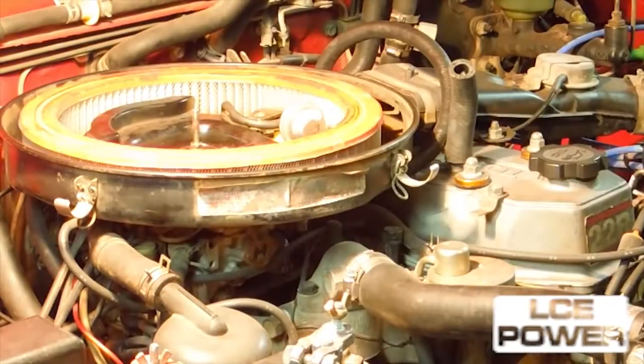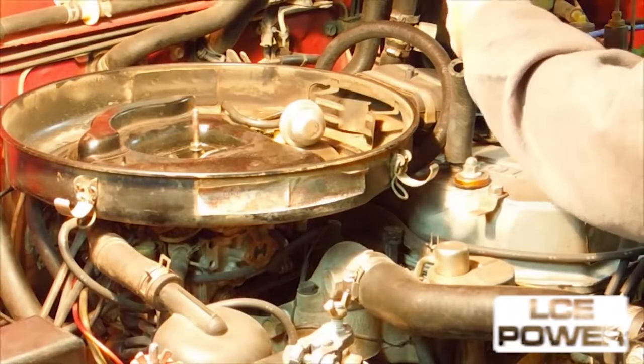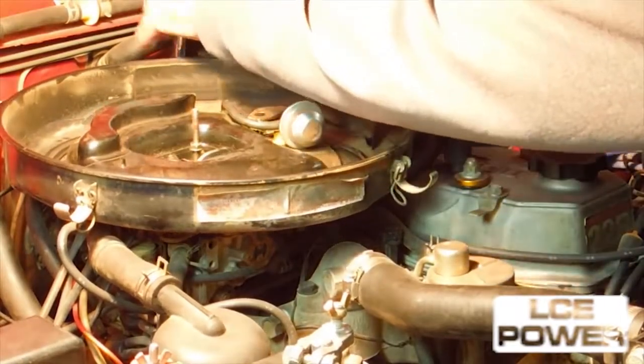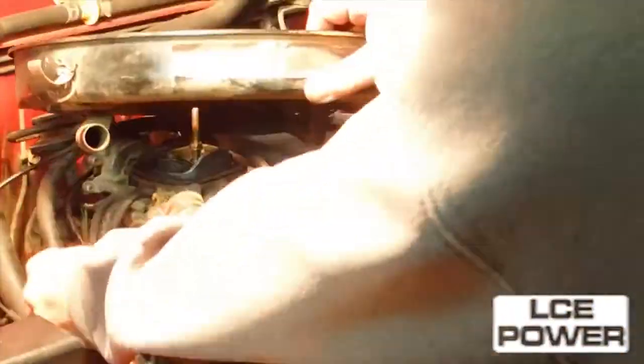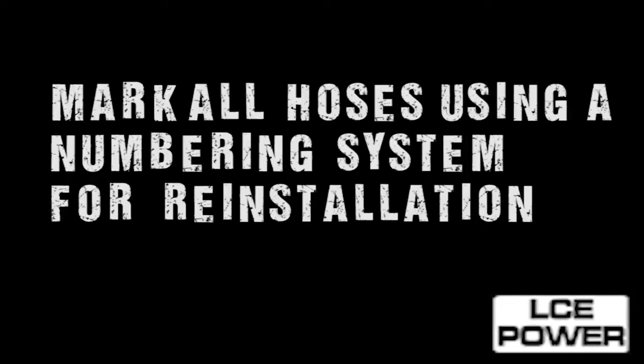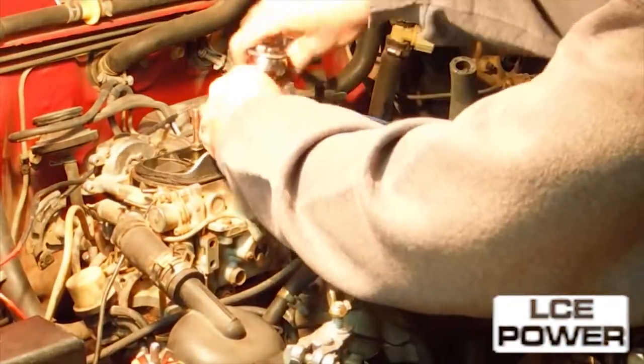In this installation of the carburetor, we will only need one vacuum line, and that will go to the outer chamber of the distributor. You can remove the electro valve bracket assembly as a unit, ensuring the vacuum lines remain on the valves in order to facilitate reinstallation of the stock carburetor if you ever wish to do so.